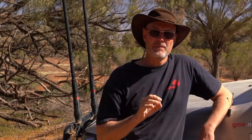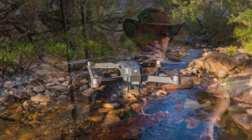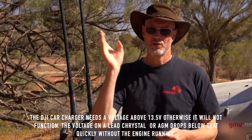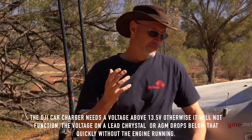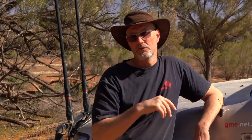While Better Batteries assured me that the bulging is no issue, it is something I really did not like. On top of that, I also realized that my drone equipment would not charge very well with a lead crystal battery or an AGM battery for that matter — simply because the drone charger needs a very high, constant voltage. If the charger sees the battery is below 13-something volts, it will not charge. That meant I could only charge my drone while driving or shortly after parking up, because the battery voltage of any AGM or lead crystal drops fairly quickly.